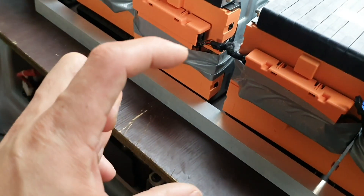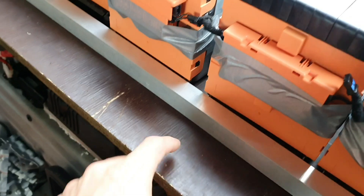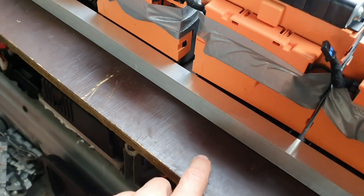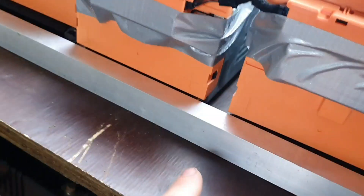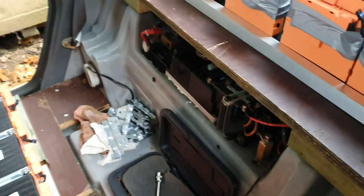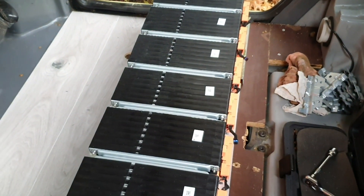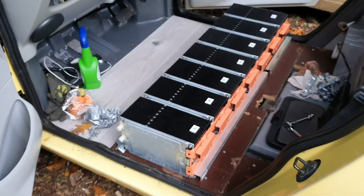To secure the top part, I'm going to get some long coach screws — really thick threads with hexagonal tops rather than crosshead or normal screws. I'll bolt those right down into here: extra long ones on this side, shorter ones there, and extra long ones in the back where there's another double bit of wood, so they'll be well secured. I just need to nip to the hardware store to get a few parts to complete this.